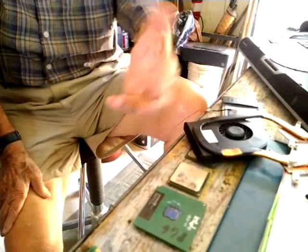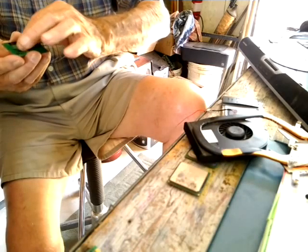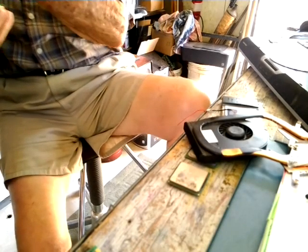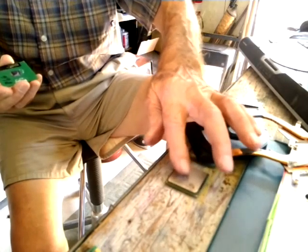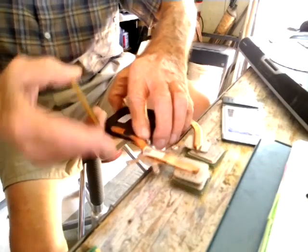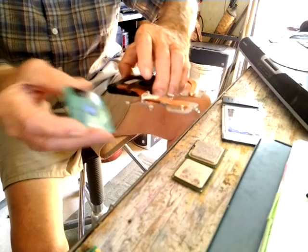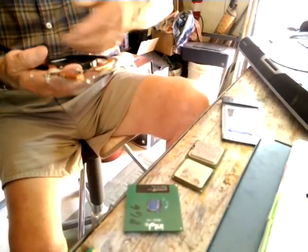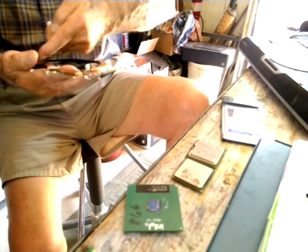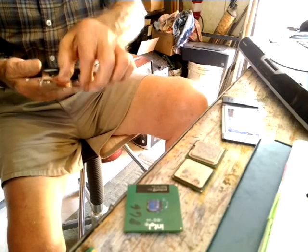This design helps get rid of the heat. Here you only got this little bit. So they apparently got something around here that takes the heat away from it. This here gets real hot, so you put that heat grease in there, and that transfers the heat to this. That copper heats up real fast, and then this blower blows the heat out, and so it keeps cooling. This keeps cooling this copper, drawing the heat away.